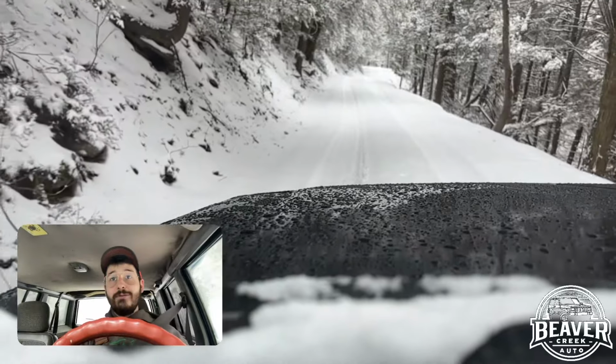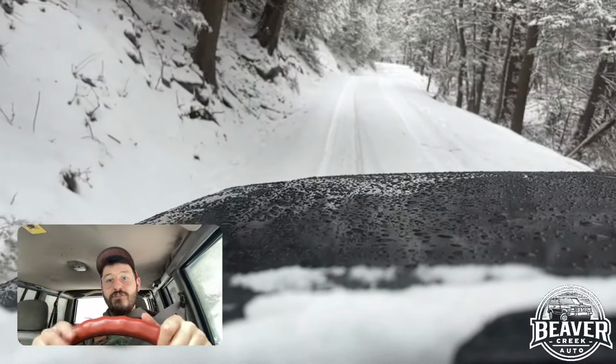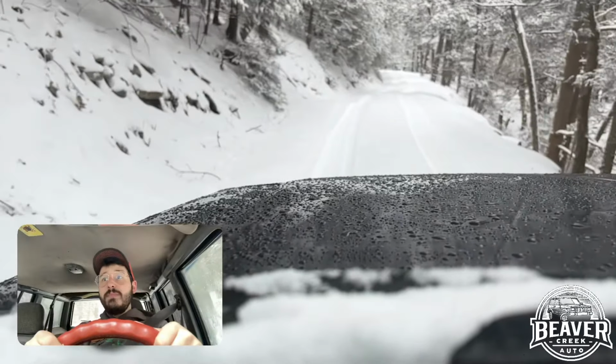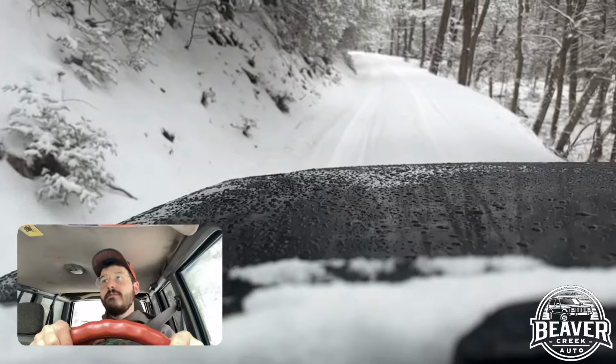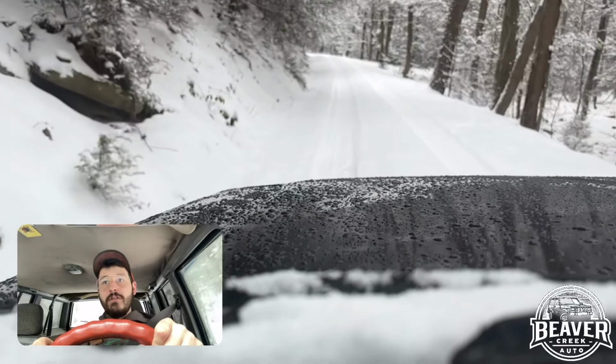Well, it's not. The weak point is not the U-joint. Surprisingly, it's the output shaft of the transfer case. So I made one thing into two things, and I have the Select-Trac in this, which is really nice in the snow.